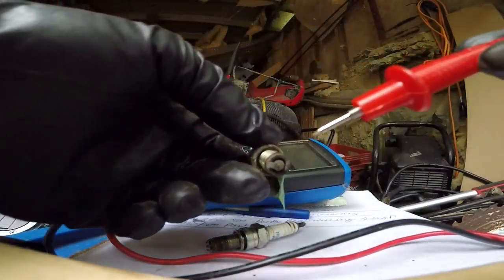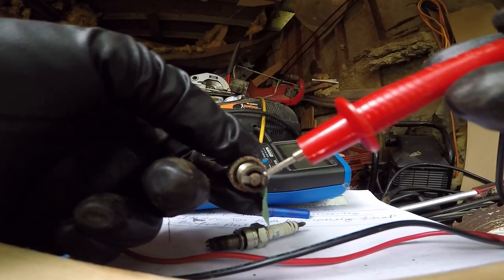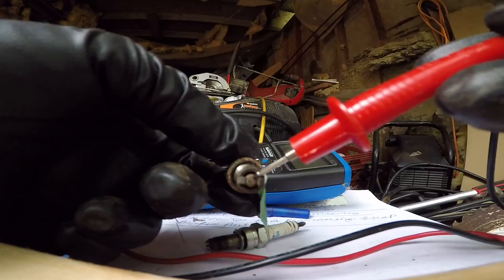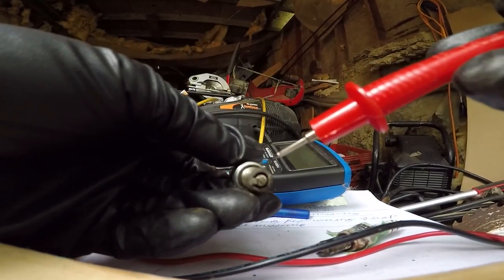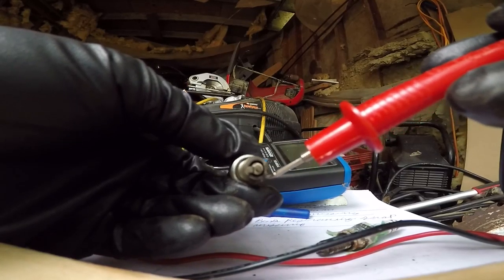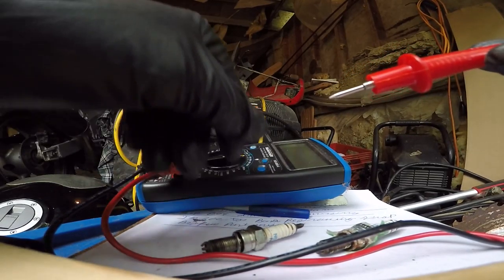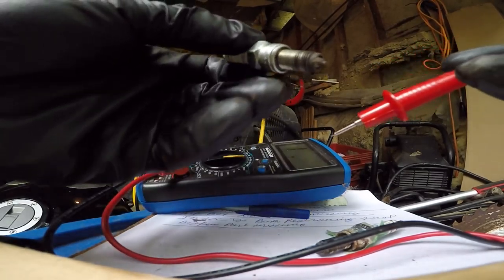That's really clean. And we can see this is number four — light tan-brown is good, there's nothing wrong with that. I don't know if this plug is any good or not, but light tan-brown tells me that's a good burn. Out of all the plugs, this one — you can see it's still kind of white in there, so it's actually a little corroded and might be a little bit on the lean side. Interesting. I'll give it a test, do it the best way I can.